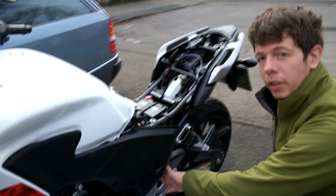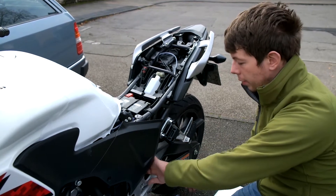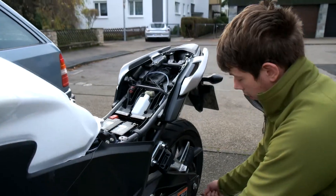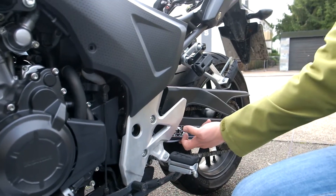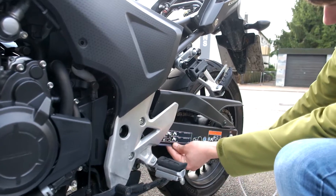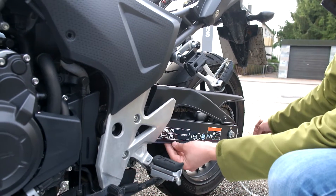Later I'm going to go around with the zip ties that I included and tighten it so that it won't fly around needlessly or get in contact with any moving parts. To run this along the swing arm, we're going to zip tie that in place later. But now that we have a rough idea where this is going to come in, we're going to cut the tube to length — make sure to leave yourself plenty to work with.